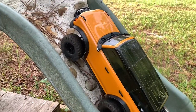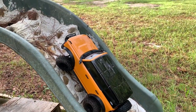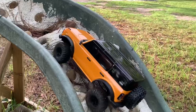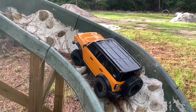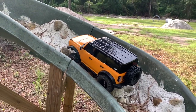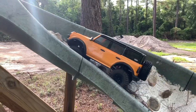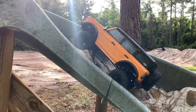Nice, gentle. Now the Fusion, just like the other AX systems, they have a great hold on them. As in, it'll actively power the rotor to hold the brake. Now granted, that is within reason. If you have it geared way too high or possibly in second gear, I think we need to go test that out with this truck. It will give up and roll, but in first gear, it holds really good. Let's see what we got going here.